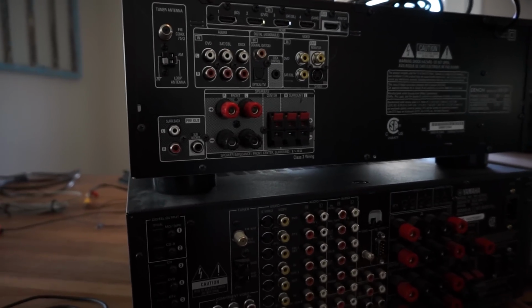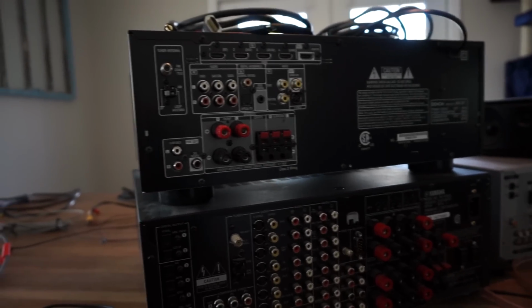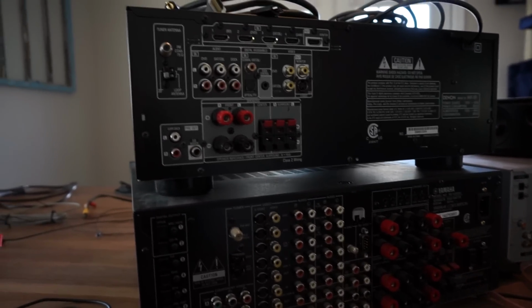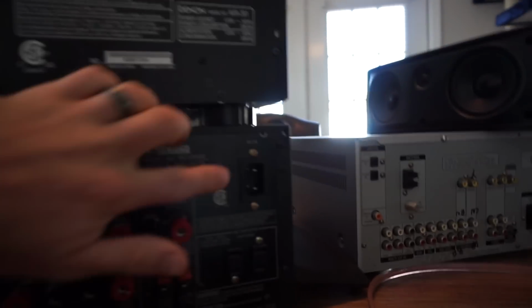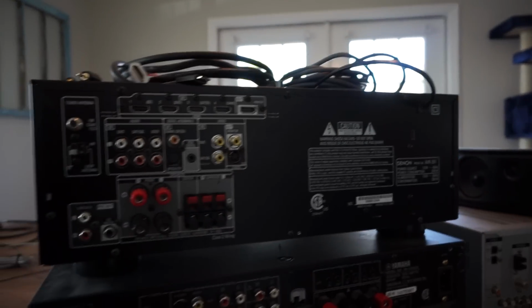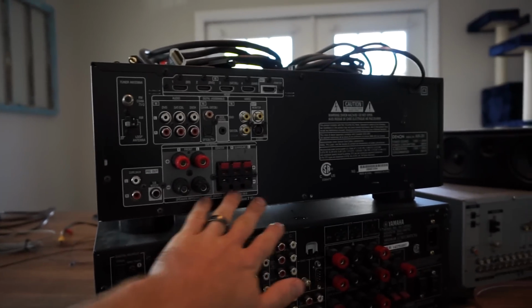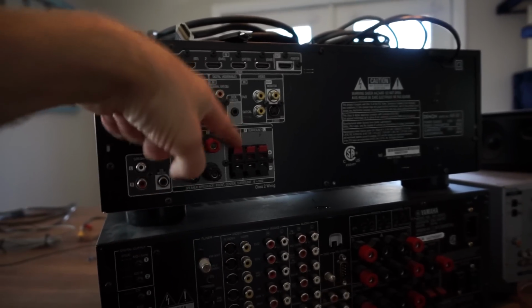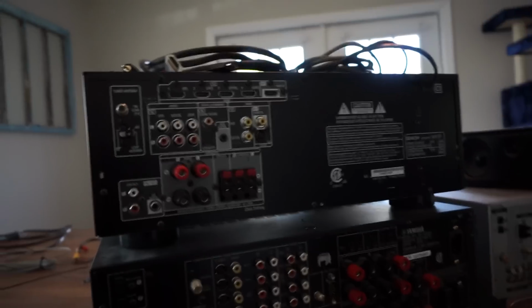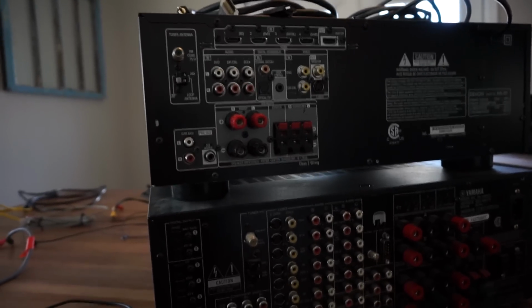Some do, but most setups will have a subwoofer that has an amplifier installed in itself. That's why a subwoofer will normally say it has 300, 400, whatever watts it has. And that's also why a subwoofer will have its own power cable normally, that plugs into the wall to give it power. So you have all your speakers, and that's also why they call it 5.1. 1, 2, 3, 4, and 5. Then the .1 is the subwoofer. If you see 5.2, you could hook up 2 subwoofers.